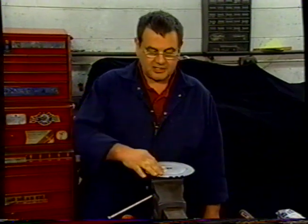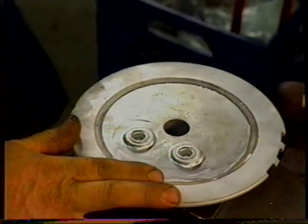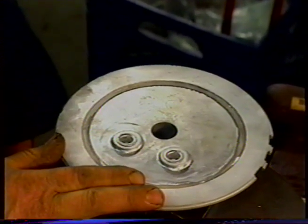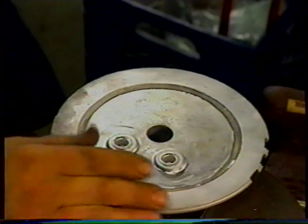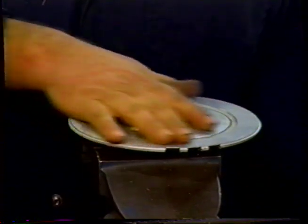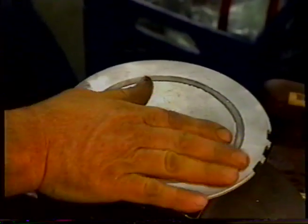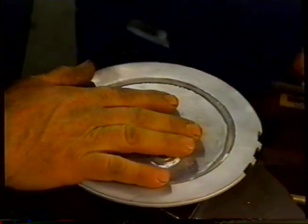This is the surface at which the servo lining runs. And the servo is just a clutch, and it's a clutch that pulls the master cylinder on. As you probably are aware, you have no direct contact with the master cylinder. When you press your foot on the brake, the rod goes to the servo, squeezes the arms, and pushes the lining against this surface. The rotation of the servo causes the master cylinders to be pulled on. So we need to have a good flat surface here that will pull that clutch on and give you a good brake.